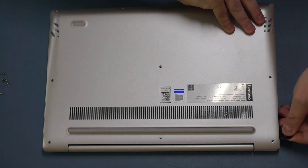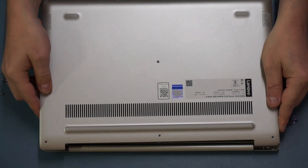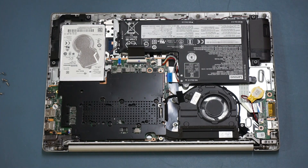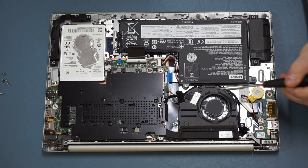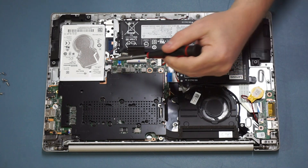The more you start to get off, the easier it becomes, and eventually the whole thing will just lift off. What we're left with is our laptop interior. Over here you've got the original hard disk. This large black section is the battery. Over here we've got a daughter board which gives us USB and the SD card reader. Then we've got the cooling fan, and then the motherboard.